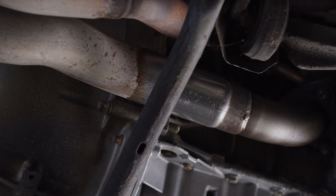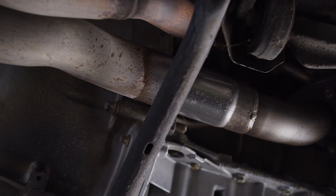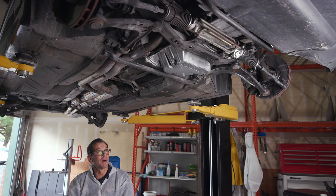And then that's a cross between hard acid and vinegar. If you were really scared, you could use vinegar instead. But that's a product called OSPHO. You can go to any hardware store and buy it. O-S-P-H-O, OSPHO. And what's beautiful about it is if you use it and then wipe it off dry, it will stay looking like that.